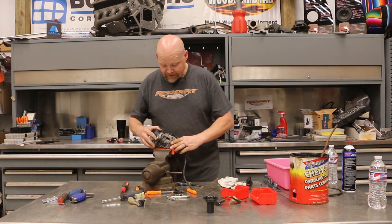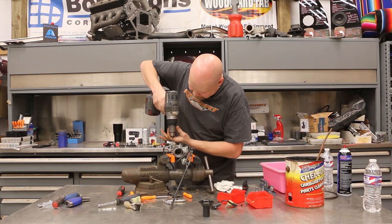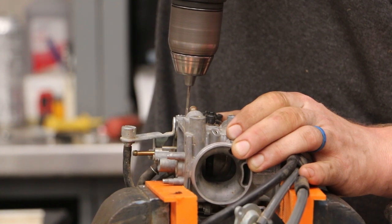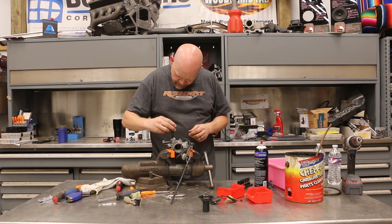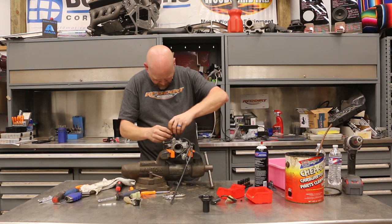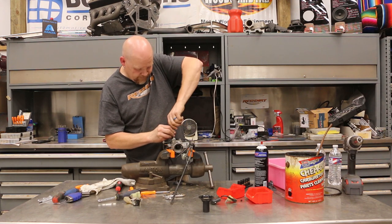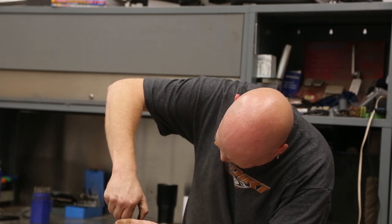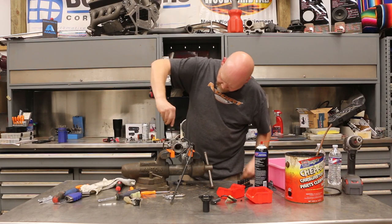Because that's what we do at Red Dirt Rods sometimes. So I'm just going to chuck this up lightly into my vise. This is a 3/32nds bit — I'm going to drill right in the center. The plan is to use these snap ring pliers to go in here and see if I can use that to twist this out. And sometimes rednecking something works — just like it is right now. So that's actually getting the job done. Nothing wrong with a little redneck engineering.